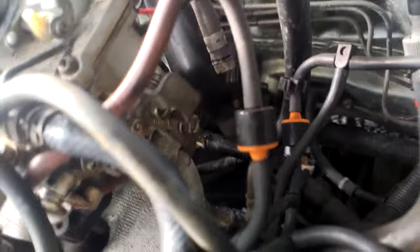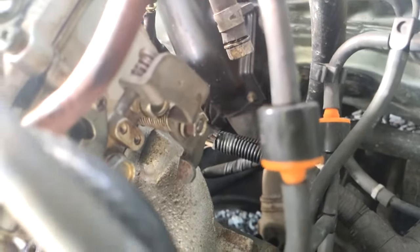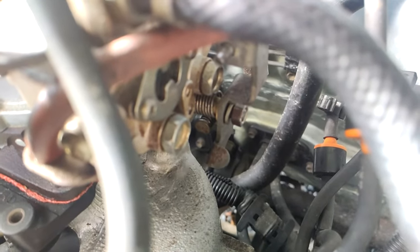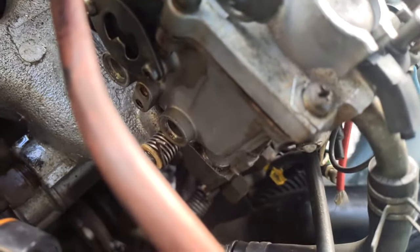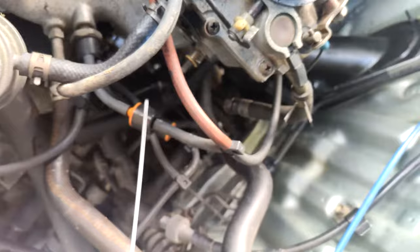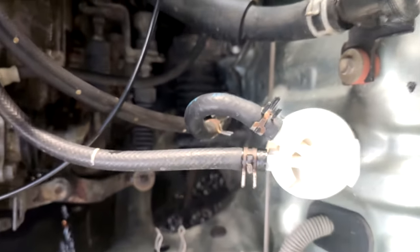Brand new fuel filter. Now pulling off a small nut off the edge of the carburetor, then pulling off these two fuel bowl screws that I've got carb cleaner to clean out with. Once you remove those fuel drains, grab a little bit of throttle carb cleaner and stick it in the hole and give it a real good squirt. I've also changed the fuel filter, which is going to help clean up any of the stuttering.